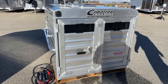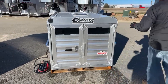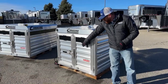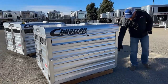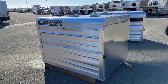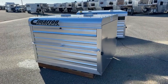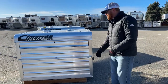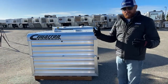Standard dimensions are 48 inches wide and 43 inches tall. Our lengths vary — you can do 60-inch or 72-inch, which are the most popular. Keep in mind you'll have some hardware here and bumpers at the front. When you push this up against the bed, it'll hit those bumpers. With the bumpers and hardware at the back, you're going to add about three inches to each box — so the 60-inch is effectively 63 inches. The 72-inch with hardware is 75. These are built to fit standard bed trucks so you can still close the tailgate.